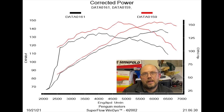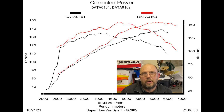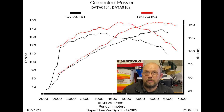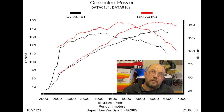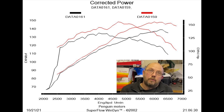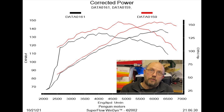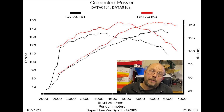In red we've got the overlay of the 40 DCoE — power and torque were up right through the rev range, win-win all round. You'll notice a difference in the start point of the test between the red and the black. With the black test on the 32-36, I started the run really low down just to see if that cam would work at really low speed with that carb, and it did.